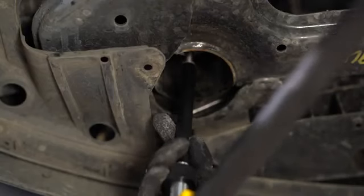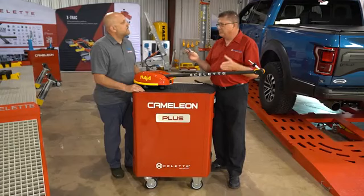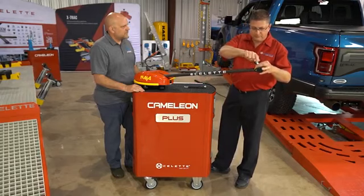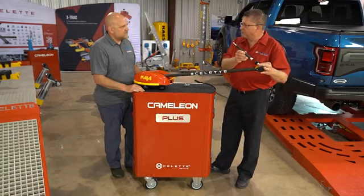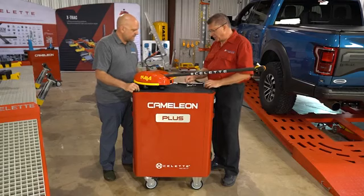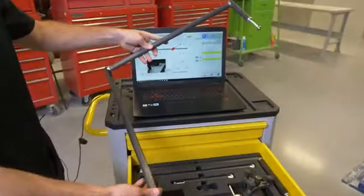We can plug in the 200 millimeter extension and measure at any angle to get around suspension points or plastic shields. The other nice thing is when you plug in this extension, the technician never has to go back to the computer and tell the system it changed — the arms are encoded. If you looked at the screen, you'd see no extension shown when one is unplugged, and once you plug in the 200 millimeter extension, it tells the computer automatically. That's important because as a technician you often get distracted, and each arm has its own driver file so it knows the exact length and shape of the extension, eliminating any tolerances.